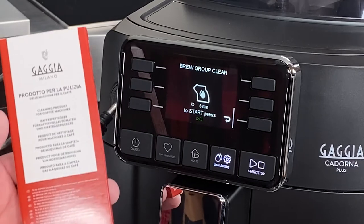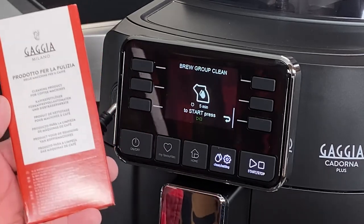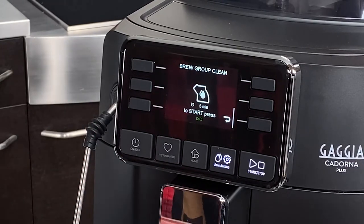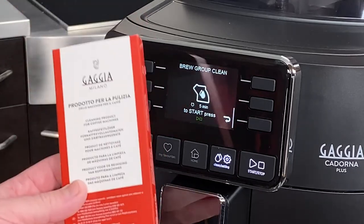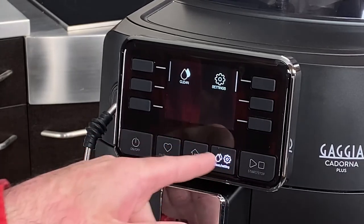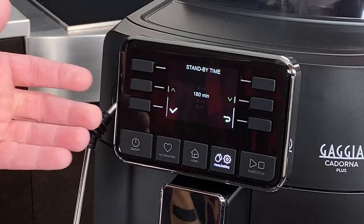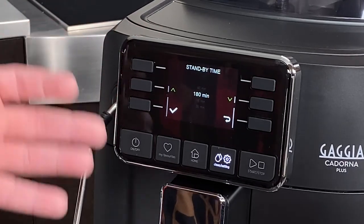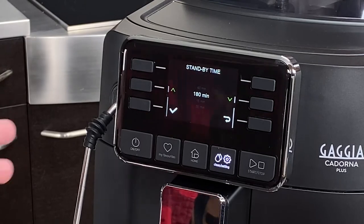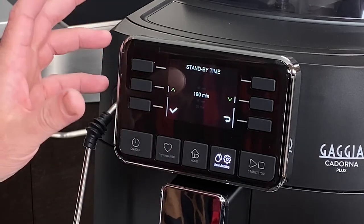The difference is that these tablets break down coffee oils that build up on the brew group and spouts. If you've ever had an old-school American-style coffee maker, you've noticed that the carafe gets kind of brown on the inside after a while — that can also occur with these spouts. So you want to use these tablets to clean them out so that your espresso is tasting its best. Standby time is how long the machine will actually stay on before it powers down. We have a range of 15 minutes up to 180 minutes — that's three hours. This will also reduce the number of times the machine rinses, because as the time expires, the machine will power down.